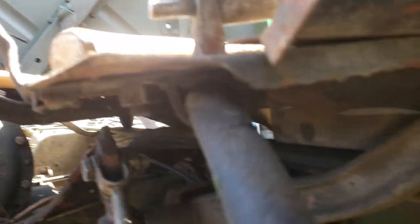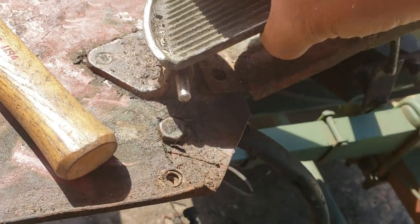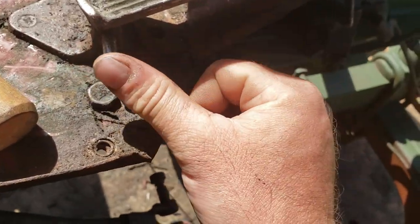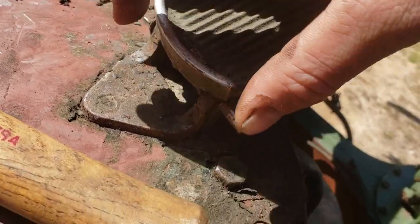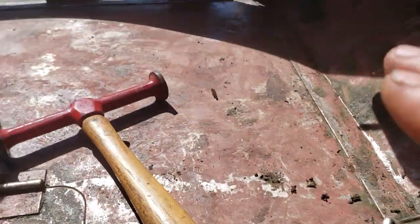Once you get it off, the pedal is supposed to swivel and the bracket is not, so what you've got to do is properly support it in a press or something and either knock or press that pin out — try not to break the ears off, because that's aluminum. Anyway, thanks for watching, guys. I hope it helps you and we'll see you later.